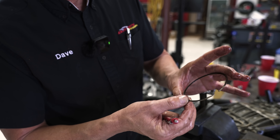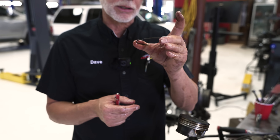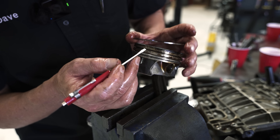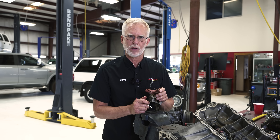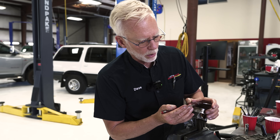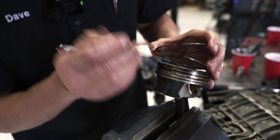Let me show you how thin this ring is - it has no tension on it, it's very flimsy. That really doesn't make a lot of tension on the cylinder wall. That tension on that ring doesn't really change with temperature. But what does change with temperature? Your oil viscosity. Oil is super thick when it's cold. This is why we're finding this problem. That's why you want SP API grade oil. The oil is getting onto the cylinder wall like it's designed to, and it's supposed to be scraped off by this oil control ring. But during cold drivability when you first start up, the oil is so thick - it's kind of like if you put molasses syrup in your microwave for 30 seconds, it pours like water. If you put it in the fridge, it won't even pour out of the bottle. So that thick oil gets past this second ring and up here to the top ring, the compression ring. That's where your problem happens.